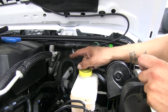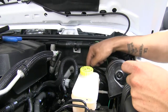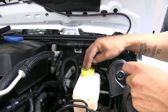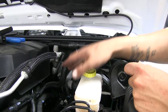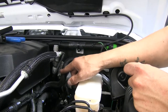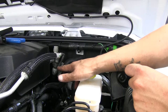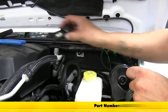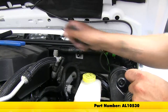Now we can get ready to work on our vacuum line connections. We're going to want to find the vacuum line that's directly connected to the brake booster, and that's going to be right here next to our brake reservoir. One thing I do want to mention: when you go to cut your vacuum lines, you don't want to use a pair of side cutters. You want a clean, flush cut — as straight as possible — so you're going to want to use an airline cutter or some kind of tubing cutter to get a nice straight cut.